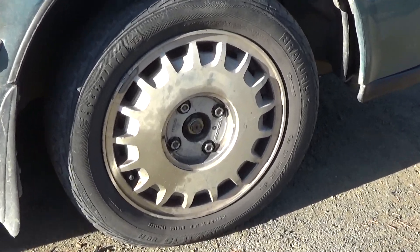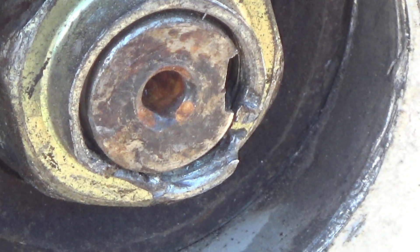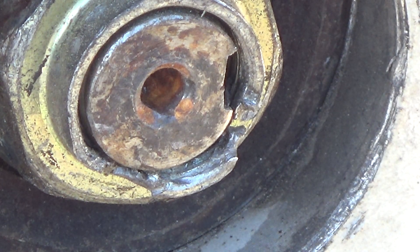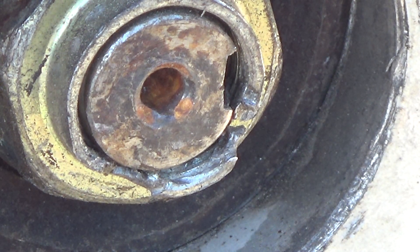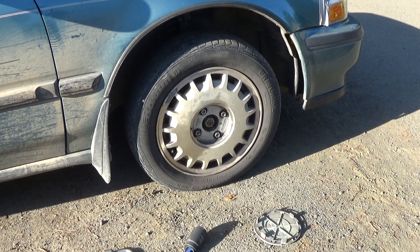Let me zoom in on this here so you can see it. You can see that notch in there — I just shoot my WD-40 straight into that notch; it helps get into those threads. And that's the part you've got to bang out so you can get that bolt loose. They call those axle spindle nuts, and those things are kind of spendy, like $3 to $4 a piece, but you might as well get one because you'll need to replace it when you're done. That's all I've done so far and I've done that on both sides.